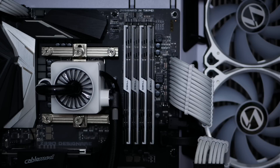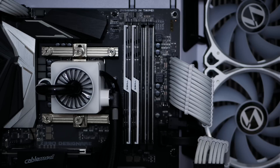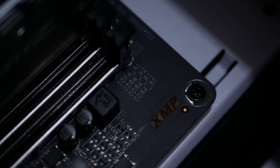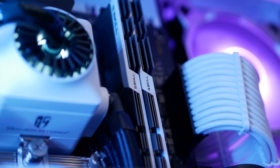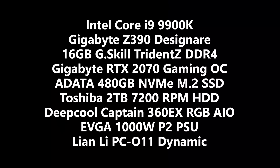The tests we'll conduct in this video are straightforward. I've got my personal rig behind me — it's the one I use for both gaming and content creation. I'll keep two G.Skill Trident Z DIMMs supporting a frequency of 3 GHz in here for the duration of this video. For the first set of tests, we'll gather our baseline data by running everything in dual-channel mode, which is what you'd expect most people to currently run. Then I'll slide one module into an adjacent slot that breaks the dual-channel config. After running through the data, we'll circle back and discuss why we saw what we saw and go into more detail on what dual-channel configurations actually do for a system.